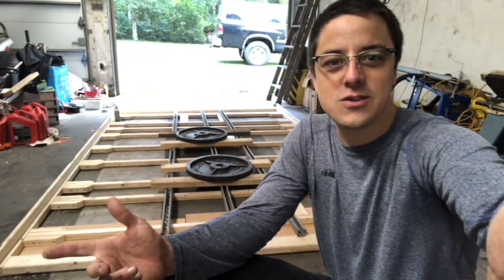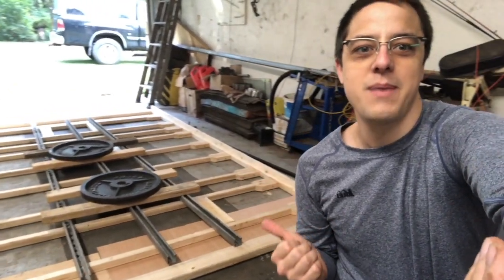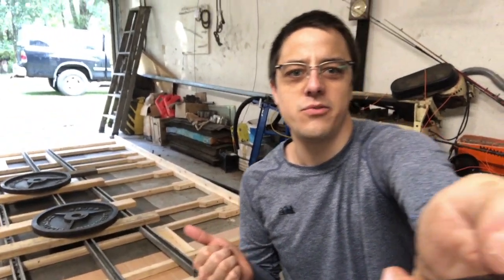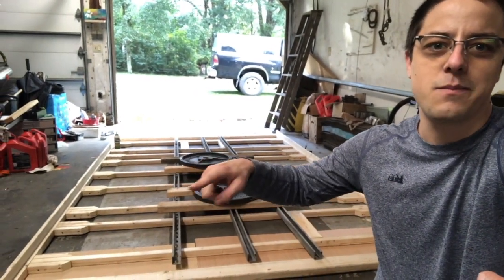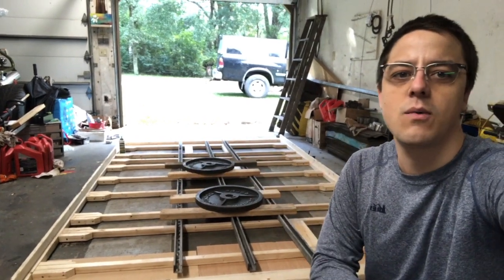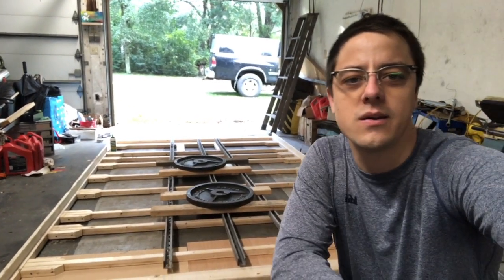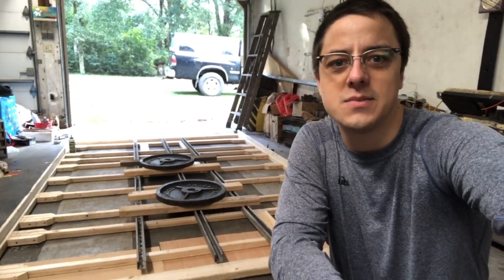We ran out of screws, so that pretty much means we're done for the day. We got the roof mostly framed out here behind us. We have the bathroom vent framed out right here, 14 by 14. We got the AC fan framed out about midway of the camper. We put it 14-14 cutout, and then a 14-14 cutout right above the rear dinette where there will be another vent with the fan and everything in there. So that pretty much sums it up for today.